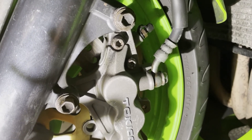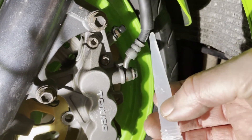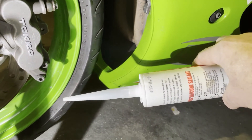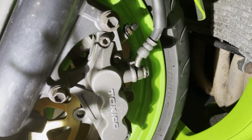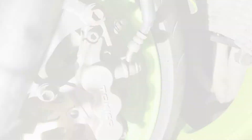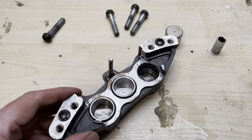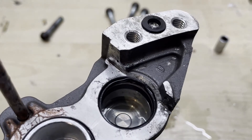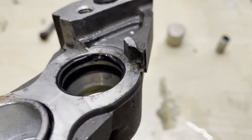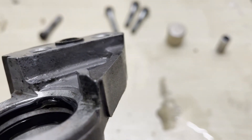I just had an idea as well - so I'm not wasting brake fluid out of the lines and out of the reservoir, I'm going to take that banjo off and bung it with this hardened silicone that's come out of the end. Let's see if it works anyway - I don't know what the official method is, whether they do it or not, maybe they just let it all drain out. That seems to do the trick, not a bad idea. It's sort of squeezing out or kinking on that one there, but that's the dust seal. I don't know if the previous seal should have prevented any oil coming past it or not.